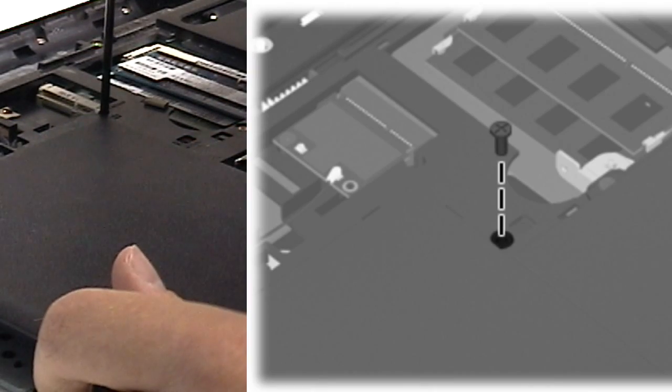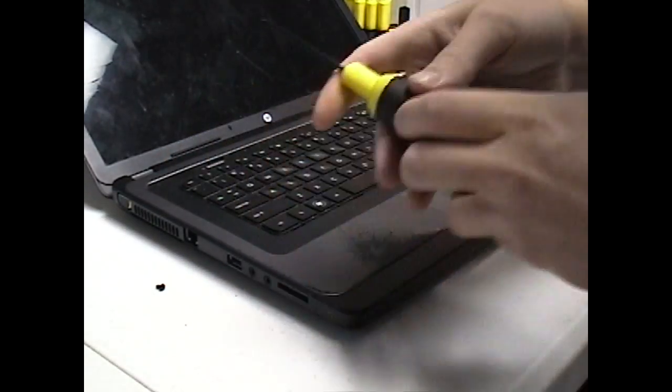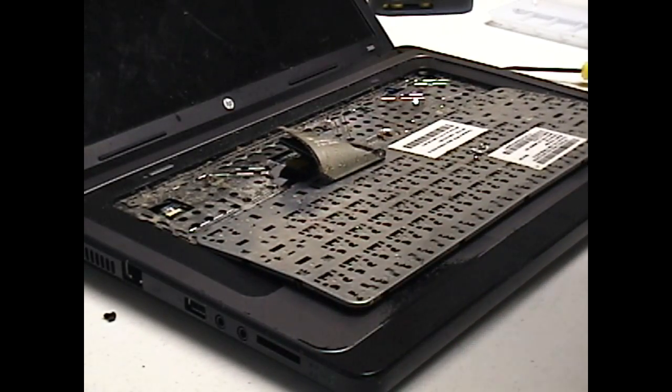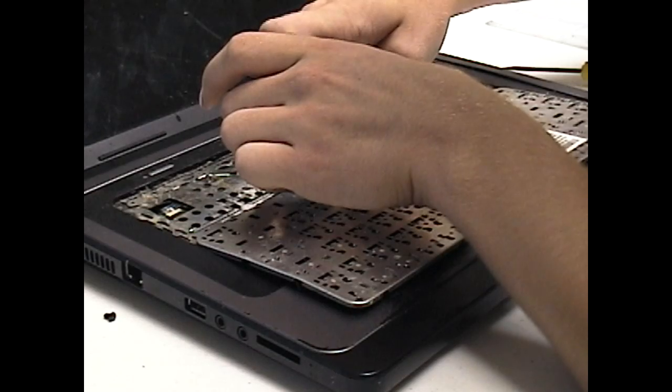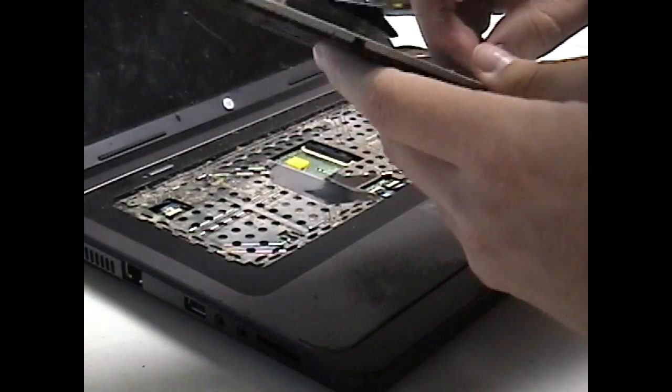Step three: you will need to remove the keyboard. There's a picture in the repair service guide that can help with this. You just remove one screw, and then the next part can get kind of dicey so watch closely. Use something pointy — in this case I had a pointy extension for the screwdriver. Hold the laptop up on its side and push into the screw hole until one or two of the keyboard clips pop out. Then it can just be pulled out by hand. From there, flip it over, set it on the palm rest, flip up the ribbon cable retainer, pull the cable out, and set the keyboard off to the side. You can also put the keyboard screw back in the hole to keep track of it.